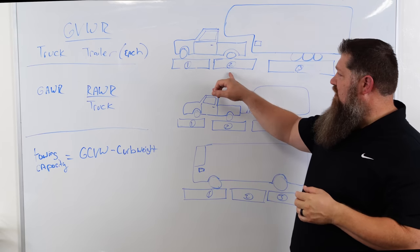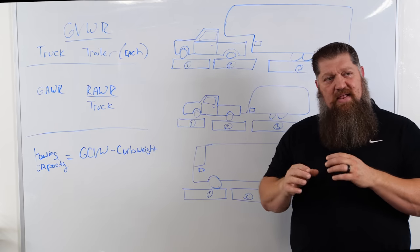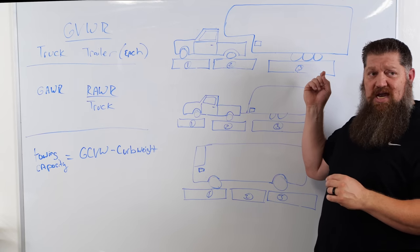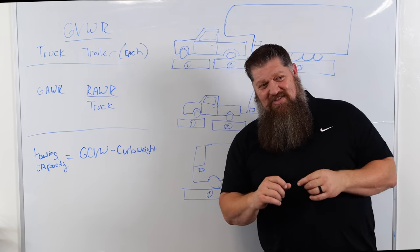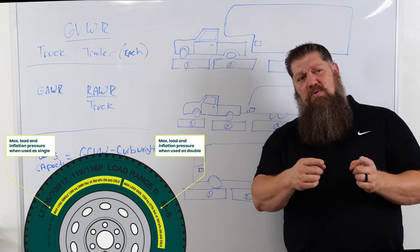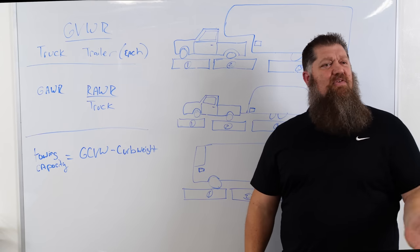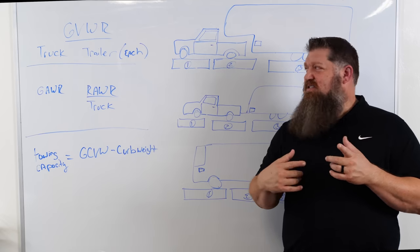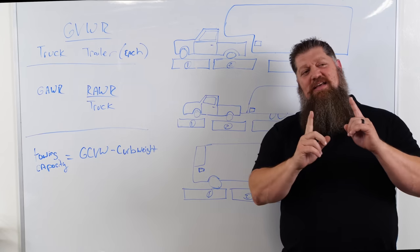Regarding tires: you can upgrade your tires on your trailer — that's totally fine. But make sure you have the proper pressure on those tires. Tires give you their maximum pressure rating cold, meaning before you've traveled down the road. You need to test the pressure before you even pull out. If you travel 10 minutes down the road, it's already too late — the pressure has already increased simply because heat increases the pressure.